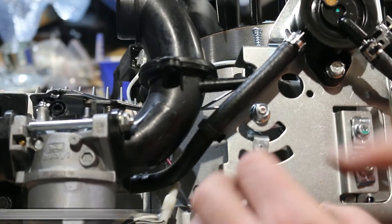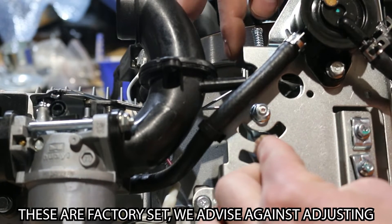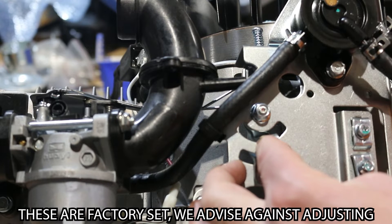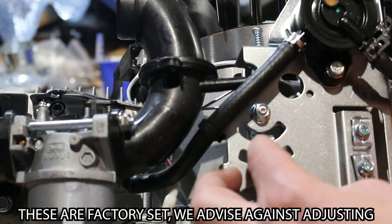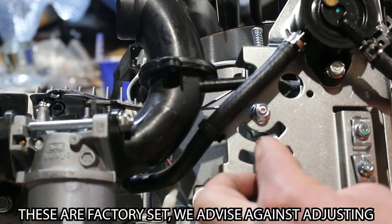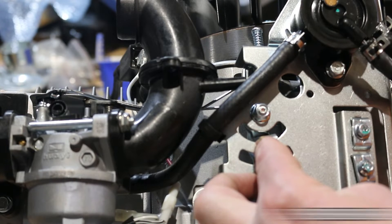This is the throttle control here and that will knock on the choke lever, and as it knocks on and puts the choke on, that will be the travel. The rev range from the factory is set with the holes to line up, which the adjustment screw is in behind, and that's sitting up 8mm.